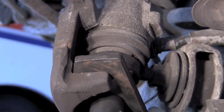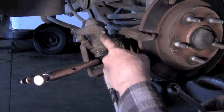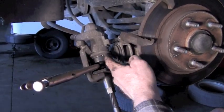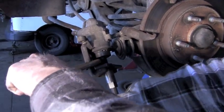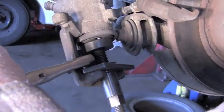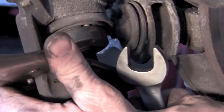When you get that done, you back this collar off. This particular unit, because it's got the emergency brake unit in it, has got a spiral to the inside of it. It requires this piston to be twisted as it is compressed. As you can see, as I turned it again it's got clearance again, so we have to adjust this up and take that clearance out.